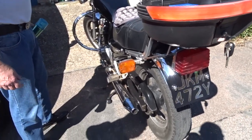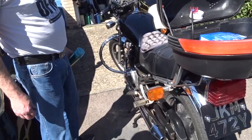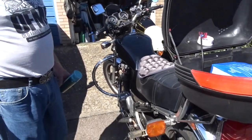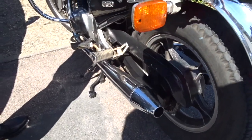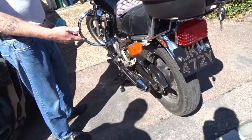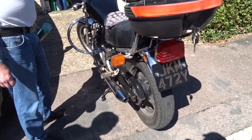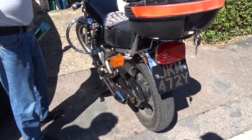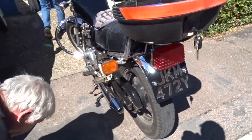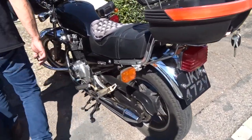I've got a Suzuki 250 GT speedo cable on there. Oh, you put a speedo cable in? No, it's the Suzuki 550 speedo cable. So you've got a speedo again then? You've got a GT 250 clutch cable, which I ain't put on yet. And the chain is off of a Bonnie. It's 106, 530, same links as on your Bonnie. Is yours 106 or 107? I've got a bigger sprocket at the front and smaller at the back. They took the half link out, there used to be a half link in it, didn't they? Should I put this in your bin?